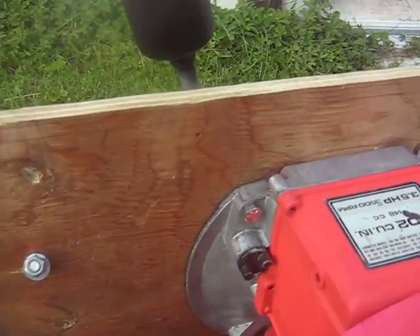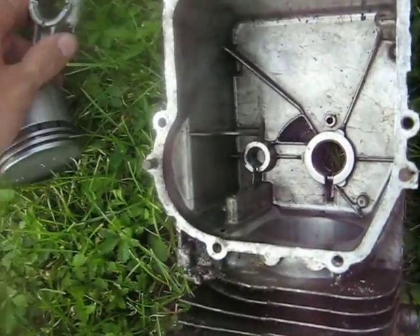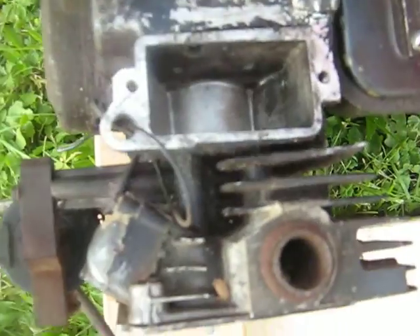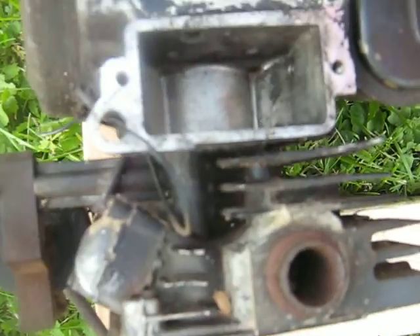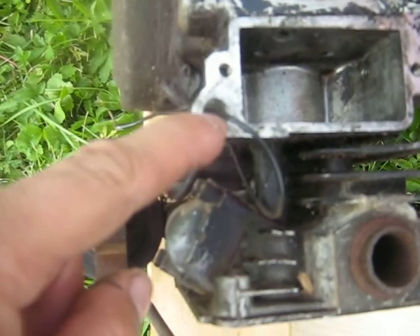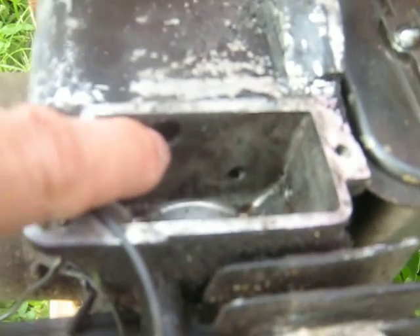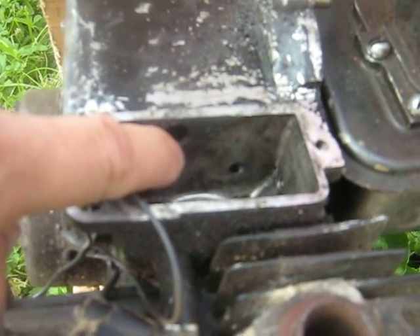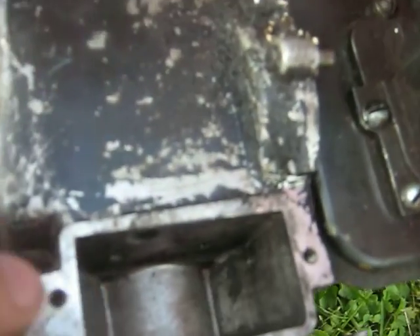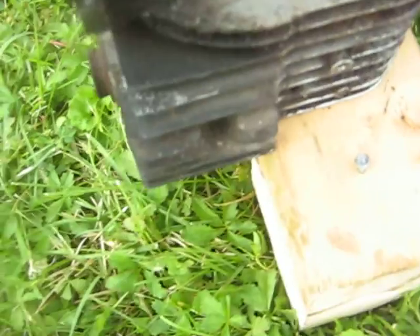The first major concern was oiling. I got another block here — I made the valve spring chamber its own little sealed unit. I plugged off the air breather hole that usually goes to the carburetor, put a plug in that, and then there is another big hole here that leads to the crankcase — I plugged that. And there is also one little tiny hole right here that I plugged as well.